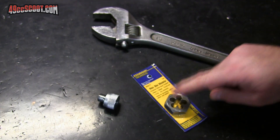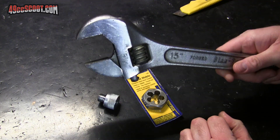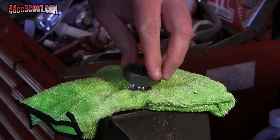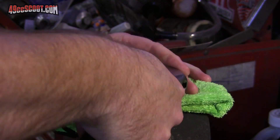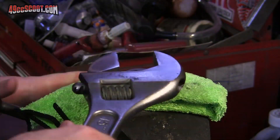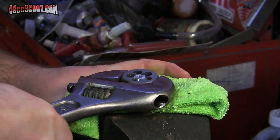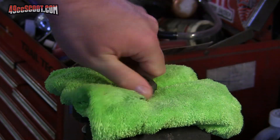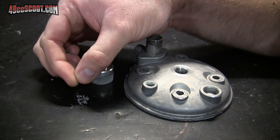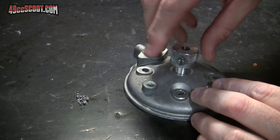It's much larger than all the other dies that I have, and I was too cheap to buy a twenty-something dollar holder, but I've got a big adjustable wrench. I figured if I need it, I'm hoping this is not a huge job for this thing. I gathered up what came off of there when I was cutting it, and it didn't take a whole lot off, but the thread certainly looked a lot cleaner and nicer than what I had produced. So now let's just see if it actually fits in the head.